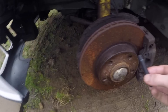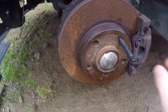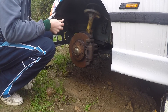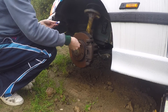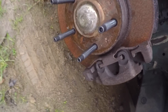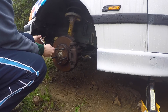I think I'm going on to talk about the joys of the stud conversion. It's quite a simple process — you just screw some studs into the hubs, once you've got the wheels off. You put some thread locker on them, and then you need to torque them down with an Allen key socket, which I'll go on to show. Once they're tightened by hand and you've used thread locker, you just need to use an Allen key socket which slots into the end of the stud, and do it up pretty tight.